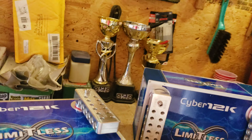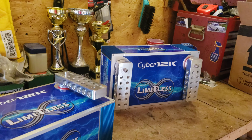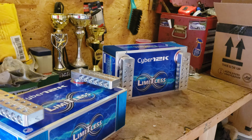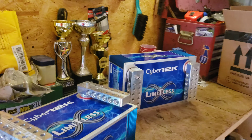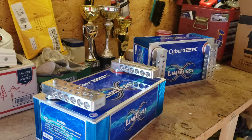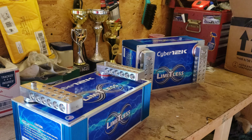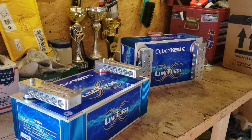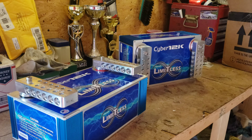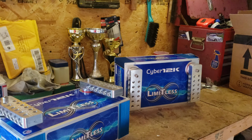These batteries are a little tricky though — you cannot mix these with lead acid or AGM, so I'll be doing a front battery delete. I've had the stuff to do that for a while, just been waiting on the batteries. This is LiFePO4 technology so you've got to be a little more careful — you can't let these discharge below 11 volts, and you cannot overcharge these above 14.8 volts. Use a little caution, but these are stout batteries.